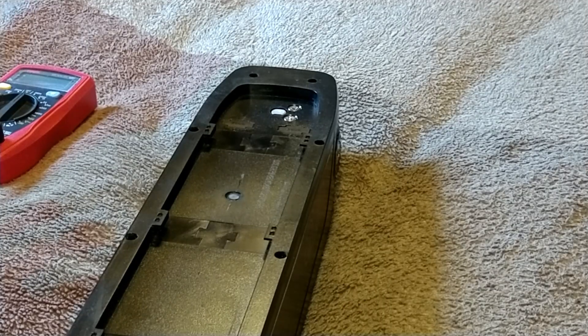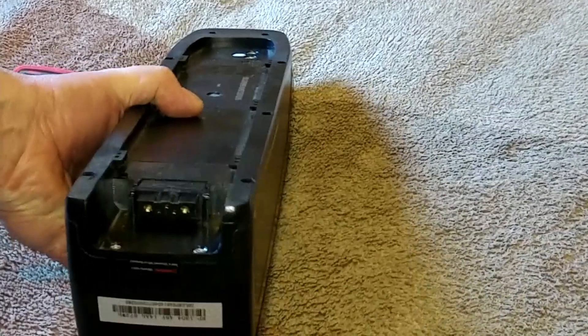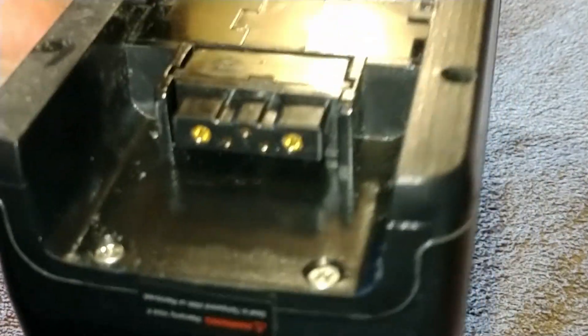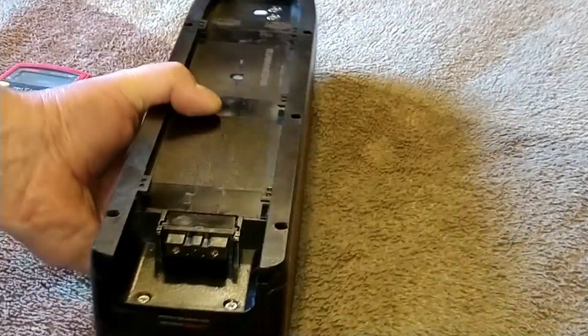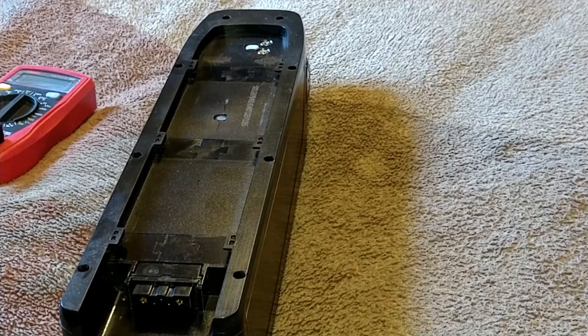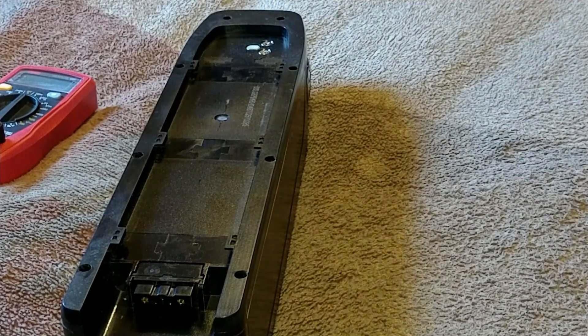Your LED readout, your controller — you know what I'm talking about. Play it safe, do it right. These batteries have no memory, so if you really need to turn the power on while charging, unplug the charger from the wall outlet before you turn the bike on. You're not going to hurt the battery — you can plug it right back in. Very simple tip: just be careful. Happy riding guys, keep safe, and I'll see you on the next video. Peace.